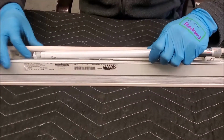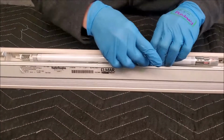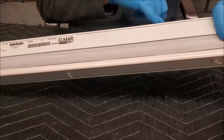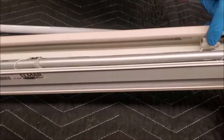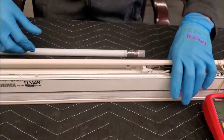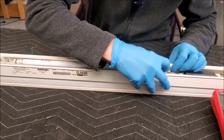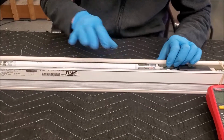Folks, it is going to be important to make sure that that goes down all the way in. Now there's no contact, but that is spring loaded, and it needs to be in a certain spot to be sure you got power. And then up here, take a look on the inside. You will see a little metal bracket right back here by my pinky, and another little button of metal right in here, and that is your positive and your negative. Got to make sure that they get good contact. Gonna ever so gently surgically replace this here battery. Get that down in, make sure we got contact.